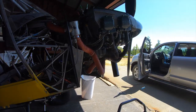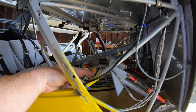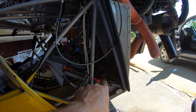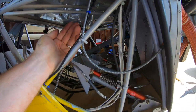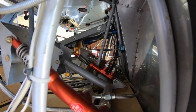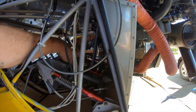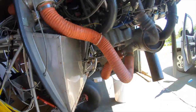I've got everything plumbed. The only one I'm going to change is this one here because there's too much hose left in it. The outboard right master cylinder on the co-pilot side had to be turned 90 degrees so the fittings faced inward to best make that work. The rest of them are facing towards the engine. The bottom one on this master goes to the brake, the top one goes over to the other master cylinder — same thing on the left side.